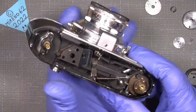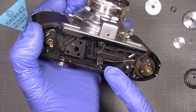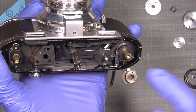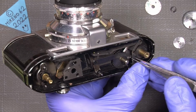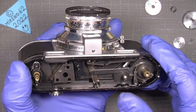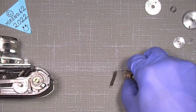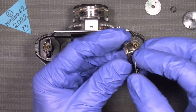So what's happened here? I will just take off the spring of the pin here and just lift up part of the advance system. You see, there are some springs underneath here, which of course will prevent it from going backward when you actually pull the shutter. So this pin here will be prevented from going backward. Yeah. So underneath here, this pin here, there's another hook. I mean, I don't know the real name for that.